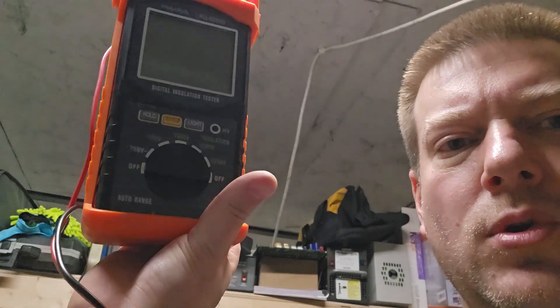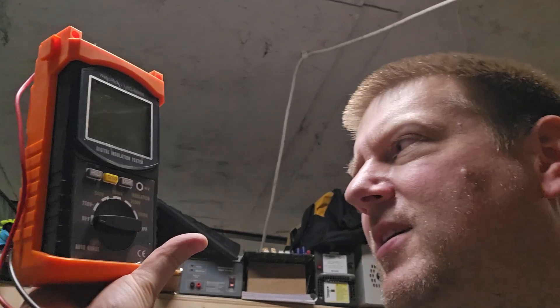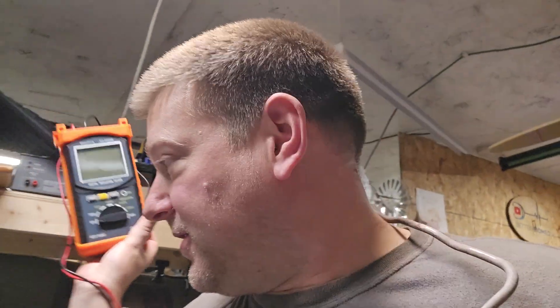I checked first the neutral and then the chassis of the device, then hot to the chassis, going all the way up to 2500 volts. At 5000 volts pretty much everything breaks through anyway, so 2500 volts is the practical limit — if I don't detect leakage, we're good to go. I put water in it, and that's why we're testing it, just in case any other components had an internal failure. An isolation tester is a pretty good device to have around for situations just like this.